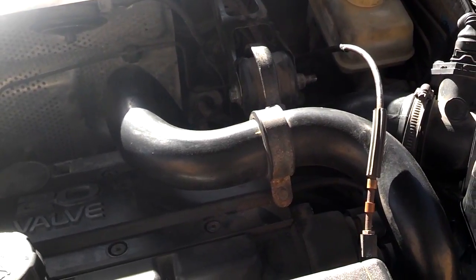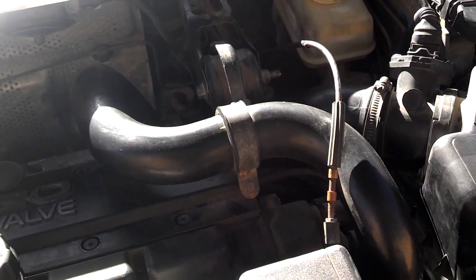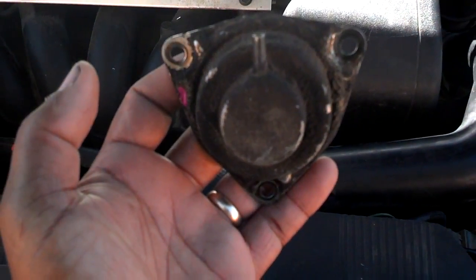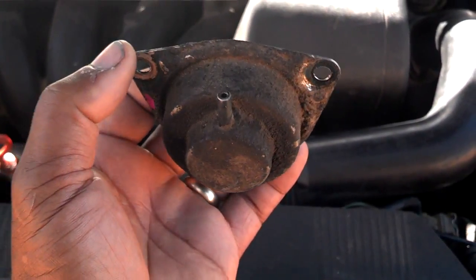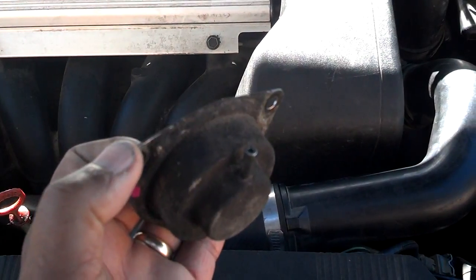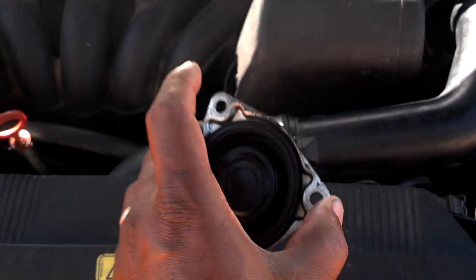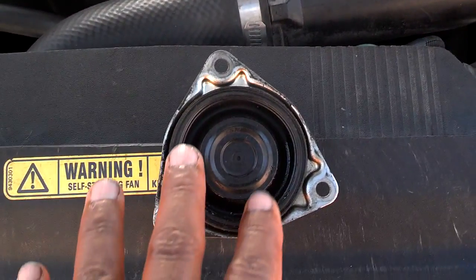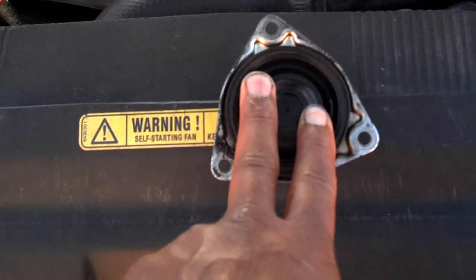Let me show you what it looks like. Because of my situation, I pulled the one off the junk yard — it would be better if you purchased these parts new. This is what that blow-off or bypass valve looks like when it's attached to the turbo. That's the little nipple on it that I pulled vacuum from. When you look at the inside, there's a rubber diaphragm. It has a little hole in the middle of it that bleeds off pressure, and it's got a spring behind it.